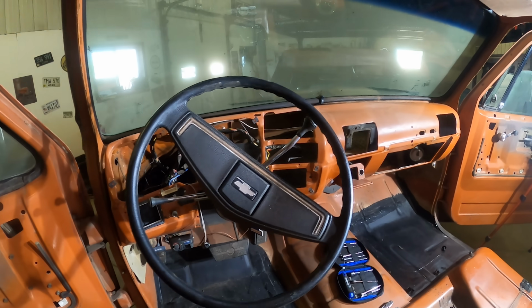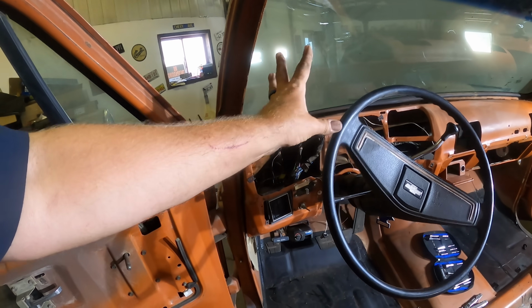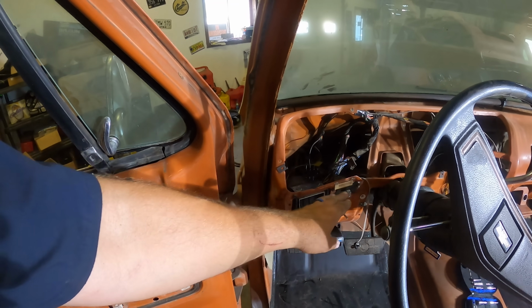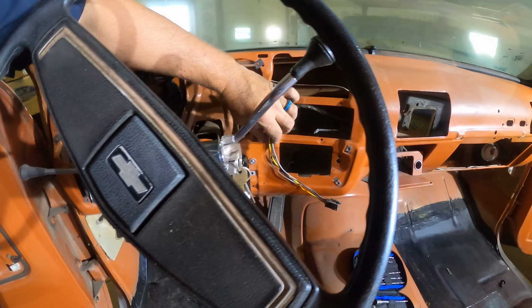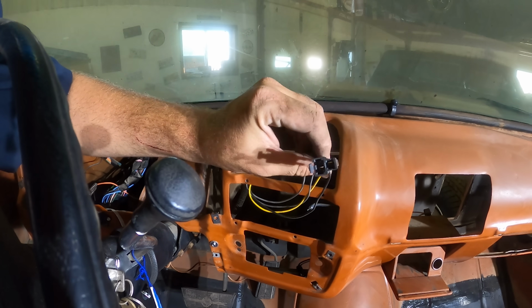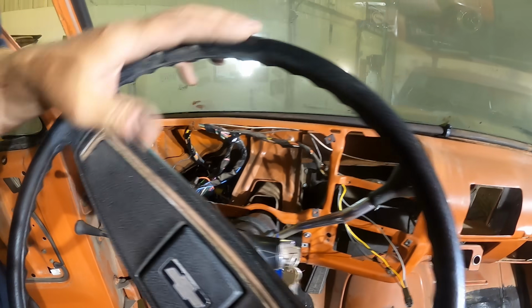Well, the guy's got this officially stripped all the way down. The only wiring that's left is the turn signal selector, column wiring, the horn, the lights, windshield washer, and then the remnants for the door switches and the AM radio here. So this is obviously power, ground, and then that must be ACC, accessory, you know, when this is all the way back.